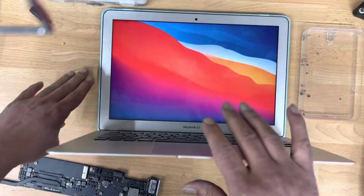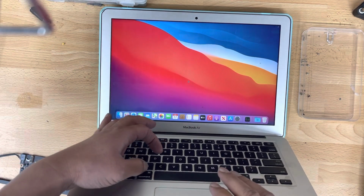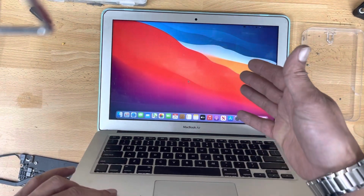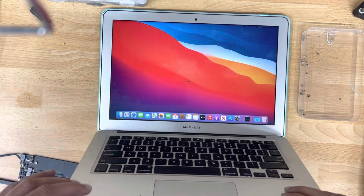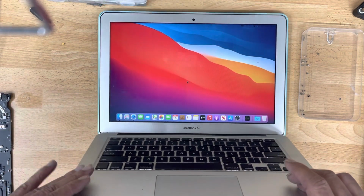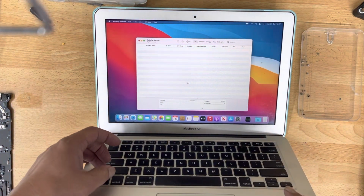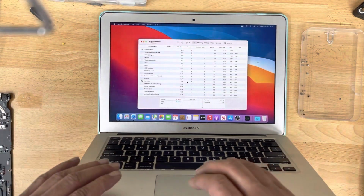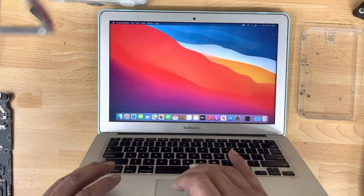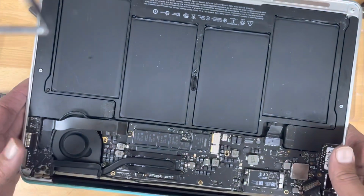Okay, I ran the diagnostic by pressing Command and D and pressing the power button. When it goes to connect, it shows you the Wi-Fi connection screen. Connect with the Wi-Fi and then you can run a diagnostic. In diagnostic it says SMC, probably SMC faulty. So I reset the SMC by pressing Shift, Control and Option and pressing the power button. It worked, but the fan is still running high. Apple Hardware Test tells me the SMC is faulty. I have no idea why it's giving the SMC faulty error.